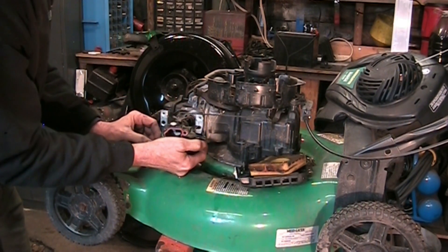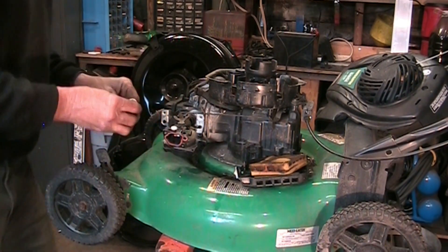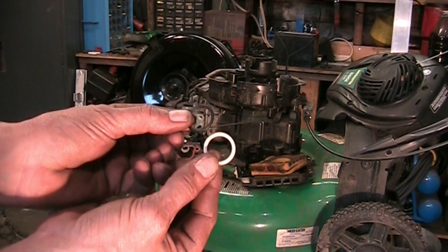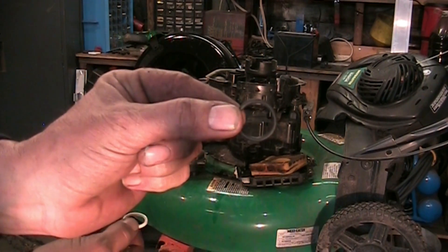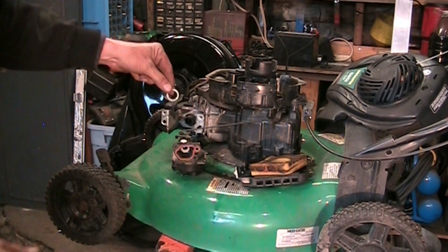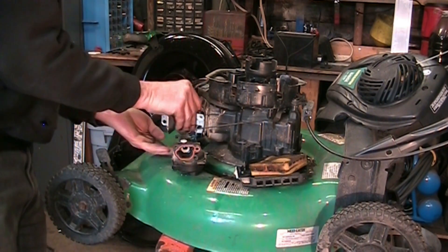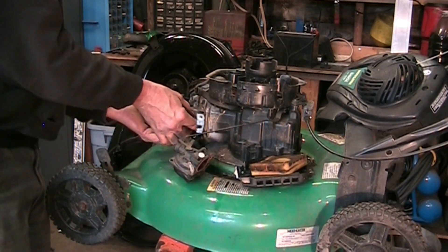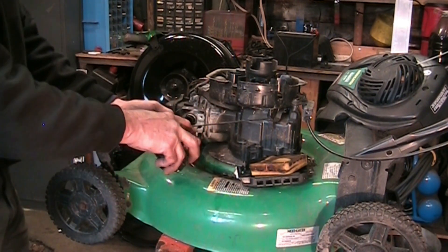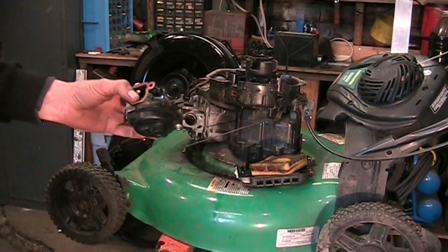There we go - everything just fell apart. This is what comes out of the back of them: the o-ring goes in the carburetor first, then the retainer. Conversely, you can put the retainer on the intake tube first, then the o-ring, then slide and pop the carburetor on - that's the way I'm going to do it. That way it gets these parts out of my hand and off the bench. There's only one hole on the top of the linkage - it's got a Z-bend, just flip it out of there. And there's that plastic carburetor.